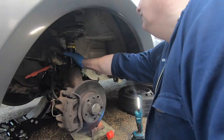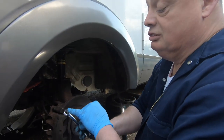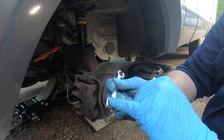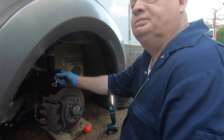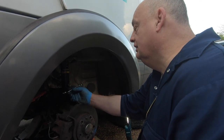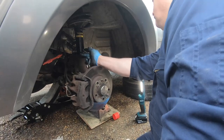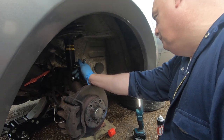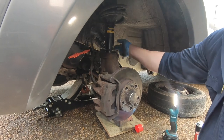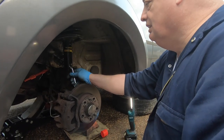So what we're going to do is attack it from the pipes at the back here and take the dual hoses off the pipes at the back. We've soaked them up. Try and get a brake pipe spanner for them because you're gripping the brake pipe on five sides of the nut — or pipe union spanners. These pipes can corrode in there, so when you're undoing those unions to the brake hose, go nice and gently and watch if the pipe is twisting as well. Because if you damage the pipe, then you're into putting brake lines in — forming new brake lines, flaring ends and all sorts of stuff. So we've given it a bit of a soak, left it ten minutes, and we'll see if we can crack them undone.